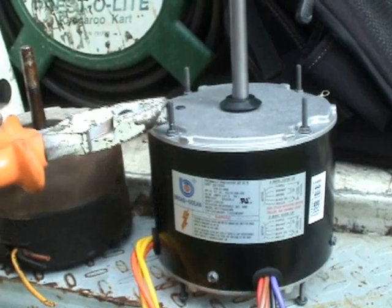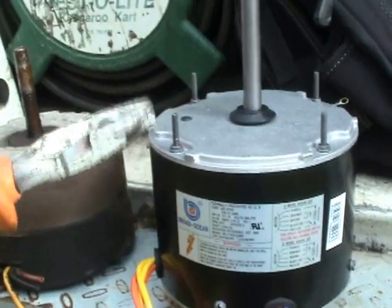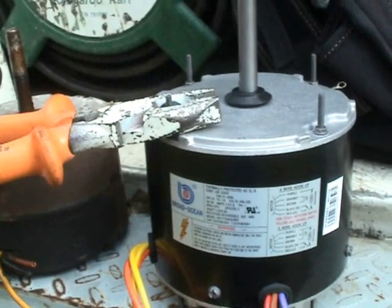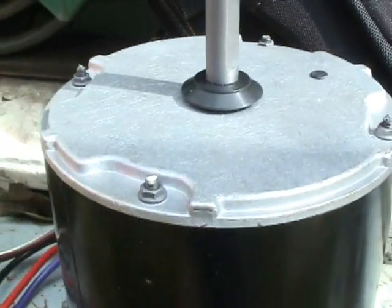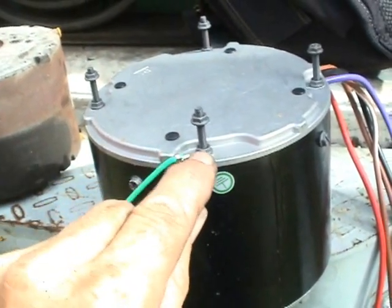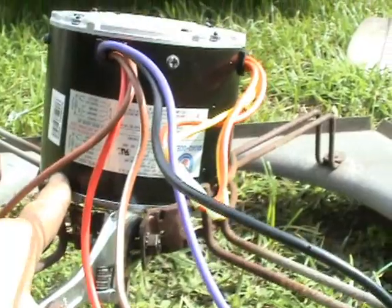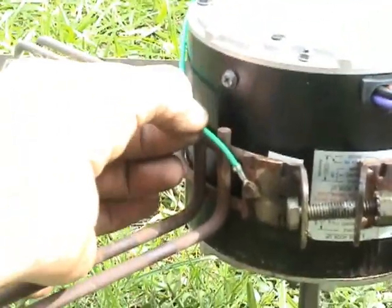I'm not going to use these bolts that go through the motor - this is for another type of mount. Remember we are using a belly band type of mount, so these bolts could become a problem with the fan blade later on, so I'm going to pop them off right now. I just cut them short - the bolts are down here and I'm going to cut them short as well. Now it's time to put this motor into place into the belly band mount - I'll have to do that with both hands off camera. Now I've mounted the motor on the belly band mount and I've even hooked up the ground wire.